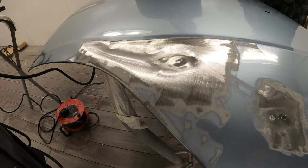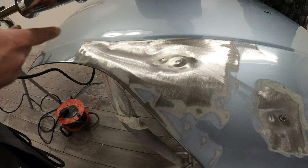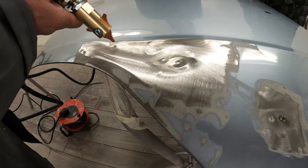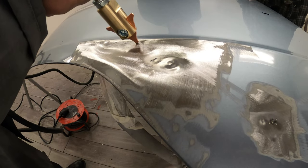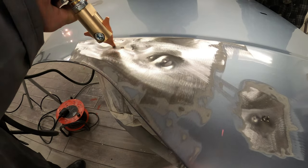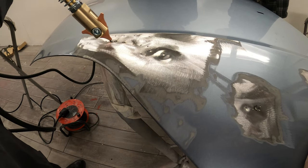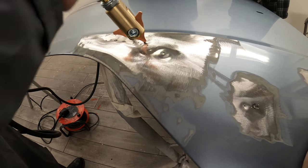We're now going to demonstrate the slide hammer, which is setting one on the machine. With it being an automatic weld, as soon as you touch the slide hammer to the panel it automatically welds, and it literally is a quick twist of the wrist to snap straight off — it won't leave any holes as long as you set the heat right. Unlike a conventional pin pulling system, this only welds for the amount of time it has been set to weld for, so there's no guesswork.